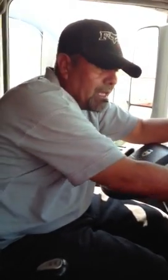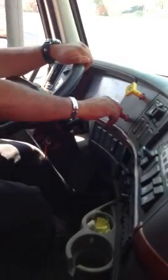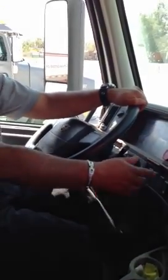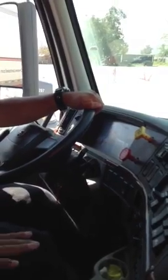Now I'm going to go ahead and put my parking brake back on on my truck. I'm going to release my trailer brake because I want to check my tractor brake now, so I push it in and let the clutch out a little bit. It's not moving — so that was good too. I'm going to put my parking brake back on on my trailer, put it in neutral, and say: this was a good test because all my brakes held.